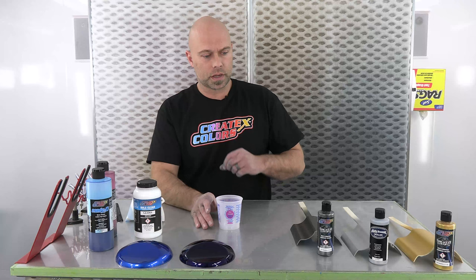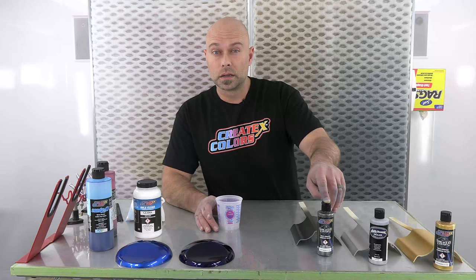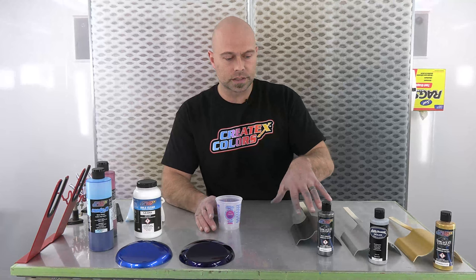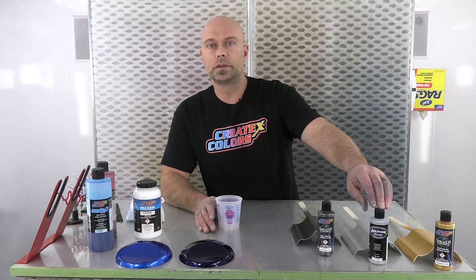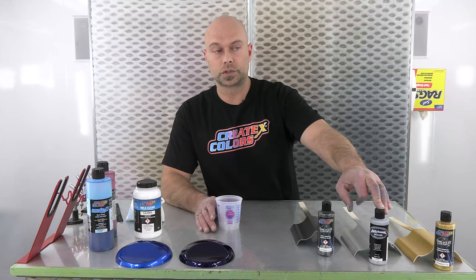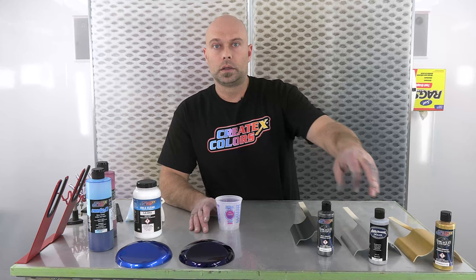This is the metallic charcoal — this was put over sealer gray, though you could put it over black or white as well. It covers extremely well, and the underlying sealer really doesn't affect this color because of the coverage strength. For the silver, we use our silver sealer 6013. That covers extremely well over basically any color — it's a great ground coat and works excellent for candies. It's right in the middle of the road in terms of a clean metallic base.